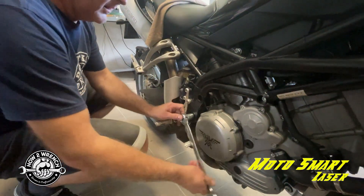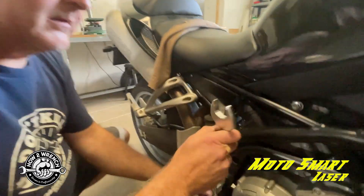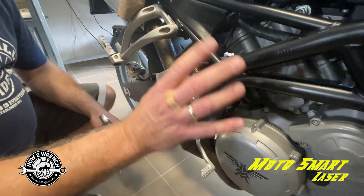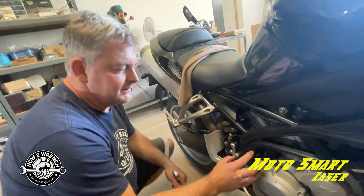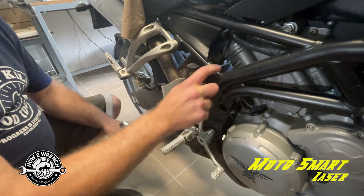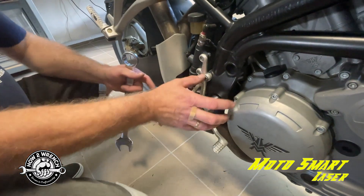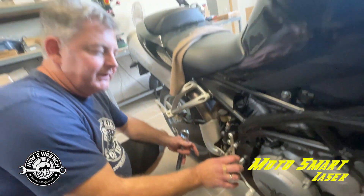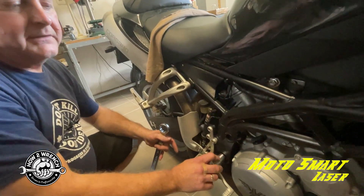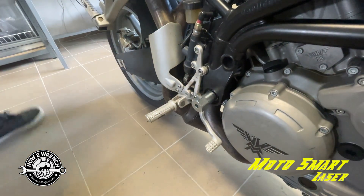Chava explains: this frame is welded, so the base points fit in the welding jig, then the welding comes, and if parts move from the jig, there's a little movement. For that reason, for correct measurements, you have to be tightened to about 50 newton meters or whatever the torque spec is — you really have to go by the spec.